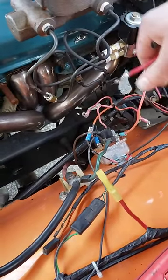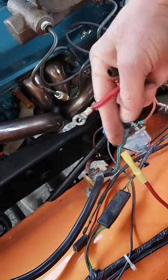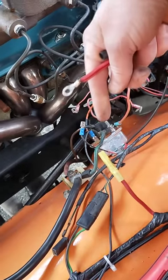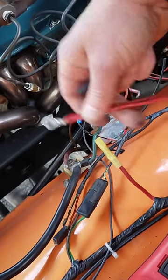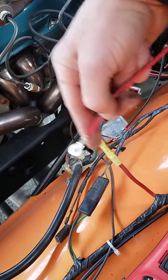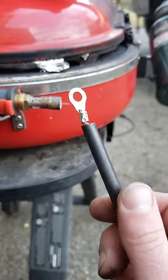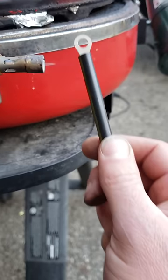While we're here, let's fix some other janky wiring. The main ignition feed or battery feed going into the ignition switch had a smaller gauge wire going to that post. Anytime you have a smaller gauge wire it's going to increase resistance, which equals heat. So I made a wire - I didn't have any wire this thick so I doubled up a medium and small gauge wire to equal the thickness. I crimped and soldered that end. You want good connections and good adhesive-lined heat shrink to seal it up.